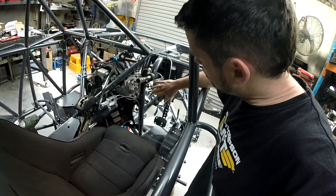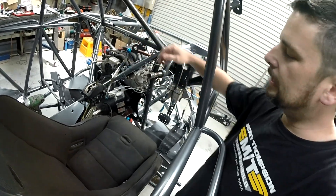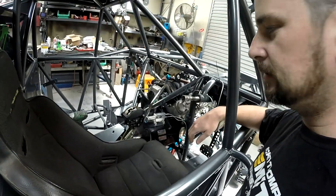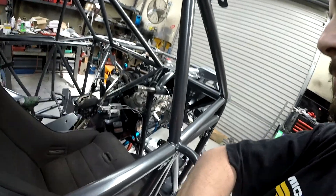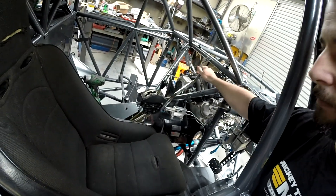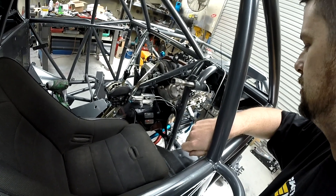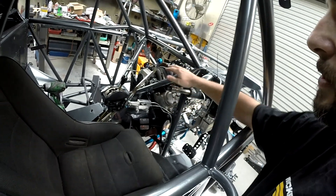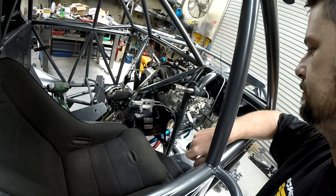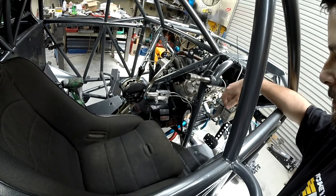In our case the rear circuit is also plumbed into our staging brake, which allows us to pull on the brake at any time — acts like a hydraulic handbrake, except it's not ratchety, it's free. It won't be floppy once it's got fluid in there. We can pull on that at any time and it'll jam on the rear brakes. When it's sitting in the neutral position, the fluid just flows through it like normal, so when you hit the brake pedal the front and rear will engage.